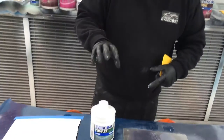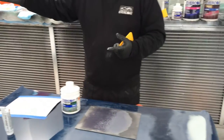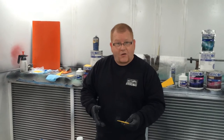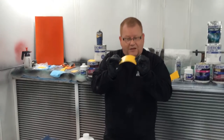We need to ensure that any filler we apply to any substrate, whether it's plastics off a motorcycle or what you're doing out there with Frankie, you'll want flexibility. The product needs to be more flexible than that to which it's being applied. If your bumper flexes this much, you need the body filler to flex this much.